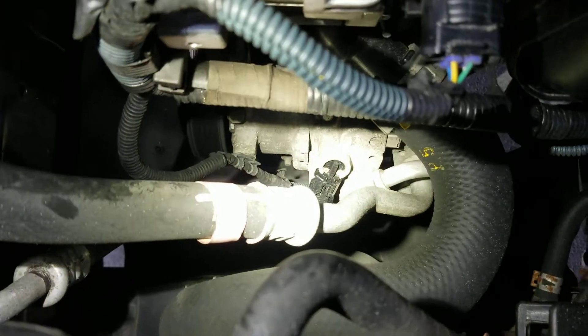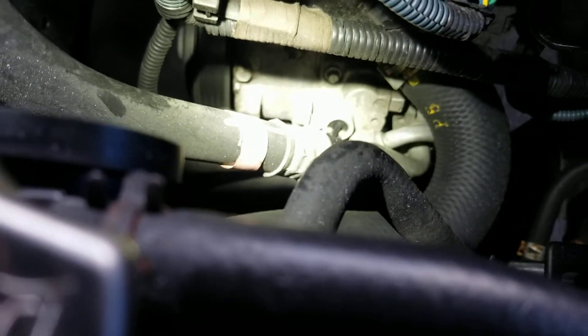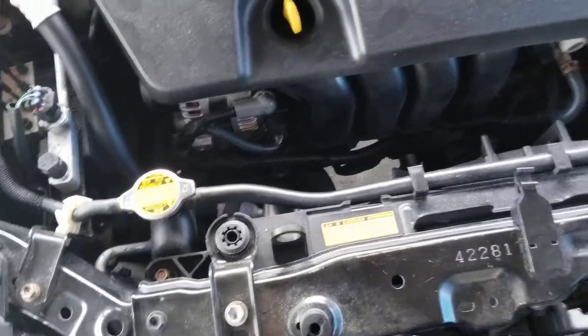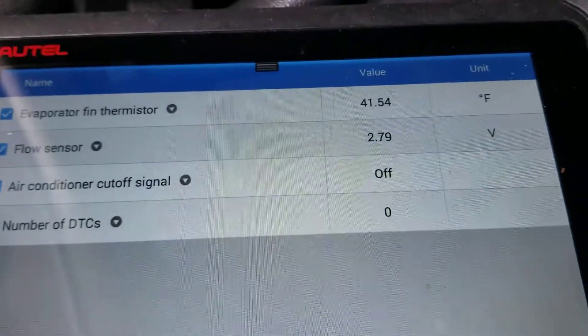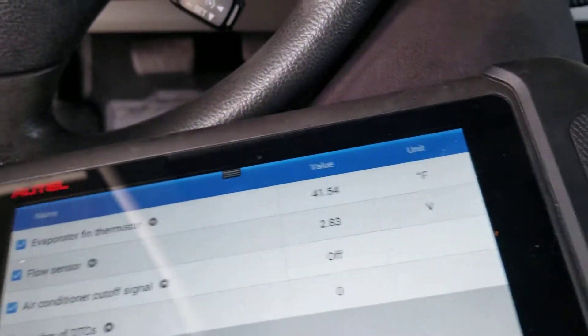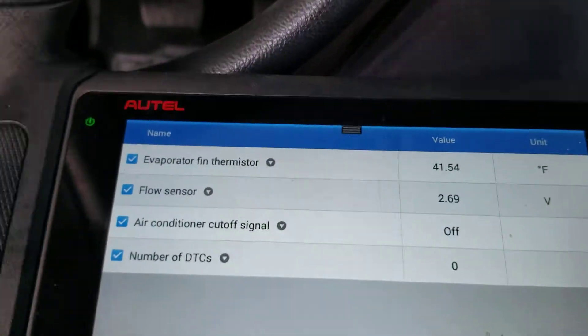The sensor is right there — see where that black connector is? That's the flow sensor. Depending on the year, make, and model it may be positioned a little differently in the compressor, but it's going to look the same. This is a 2013 Toyota Corolla, and I've changed them on TCs and either a Corolla or Camry as well. So there you have it: about four volts when off, drops to about two-and-a-half to two-point-seven when on, and as you accelerate, more flow means less voltage. Thanks for watching — please like and subscribe and we'll catch you on the next one!